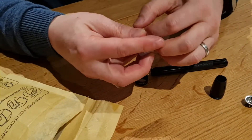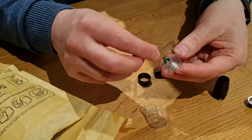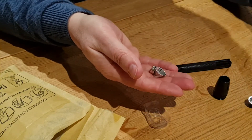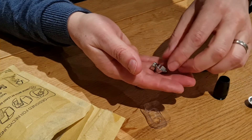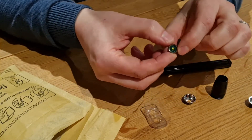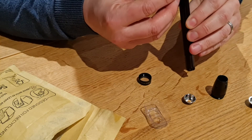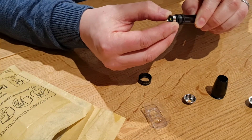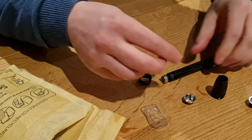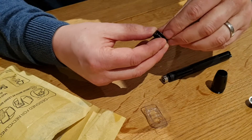Just remove this piece of tape. I'll put links to this kit in the description. Just pop that out. Here's our new reflector and here is our new LED unit. That is a straight swap into here. It is polarised, so the instructions do say if it doesn't work the first time you have to pull it out and turn it around. Fingers crossed we've got it right first time, and then the new reflector goes in there.